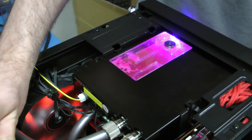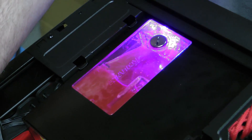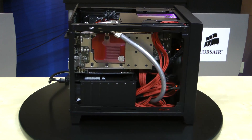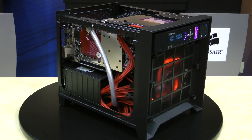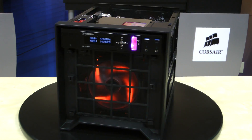Finally, you want to rock the system back and forth a little bit to work the air out of the loop, and running it overnight isn't a bad idea. The system is now complete and powered. In retrospect, I'm not sure I would have gone with the EKWB blocks for the Radeon or the processor, and I would have used a thinner 140mm radiator for the front.